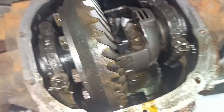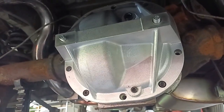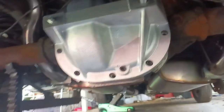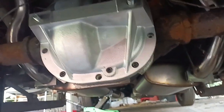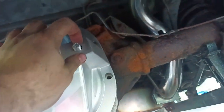You can see sand up in there — I'm gonna get all that cleaned out the best I can and get the new diff cover on. I obviously have to clean this out a little bit better with some parts cleaner and I need to add the fluid, but I just got this set up there. That's the diff cover — that's how it's gonna look. It's got the preloads. I'm using the gasket this time. I've known a lot of people that have run these with no issue. It does have a fill hole and a drain hole, so I'm super excited about that — it'll make things a lot easier.